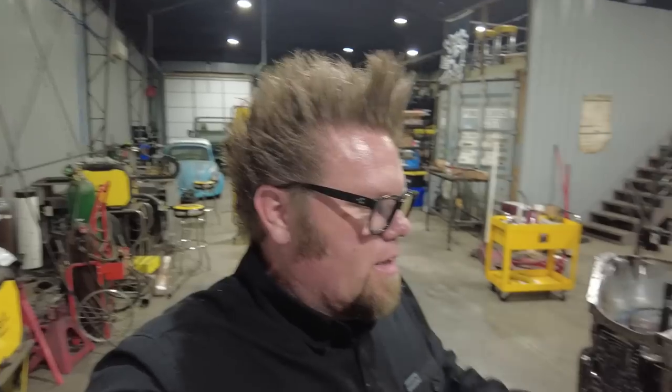I was just tearing it apart to get a good look at it and also put in that reverse manual valve body. So I'm not going to tear into the pump because, as I said before, the transmission was working fine, and if the transmission is working fine, then the pump is fine. So I'm going to go ahead and replace those seals, the gasket, pump bolts, drop the pump in, and then the internals of the transmission are done, and we can move on to the actual valve.